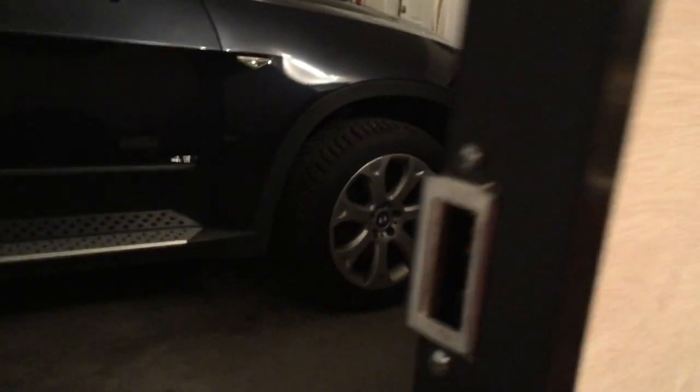This door right here incorporates very nicely. Got the locks on there. I haven't fully secured and fastened it in yet, because I am putting 0.032 aluminum white-painted aluminum siding on the side of the trailer. I'm going to fasten, glue, and screw that all down, and the doors and windows will be the very last things to go on.